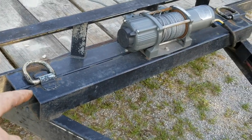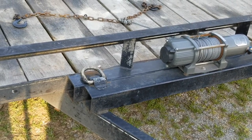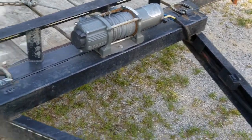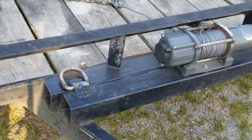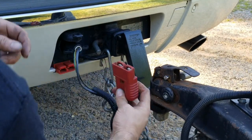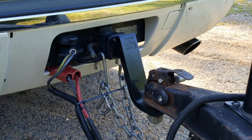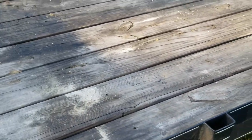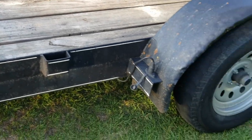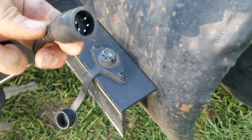I bought two-inch tubing at my local metal supply place, cut it up, and welded it onto the tongue here. I got these D-rings from Harbor Freight and welded them on there to strap cars down pretty good. It is wired to the truck — right here is a winch quick disconnect and it's wired all the way to the battery of the truck so I never have to worry about having power for the winch. Then I did the upgrade for the wireless controller and it's mounted under the deck of the trailer. If I want to use my wired controller, I just unplug the wireless controller here and plug the wired controller in.